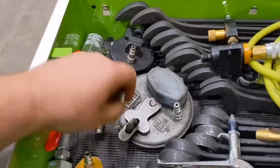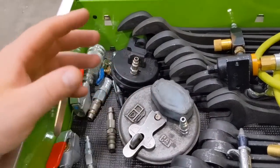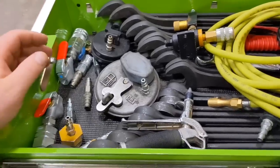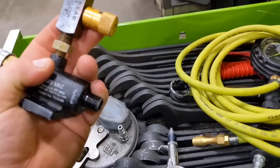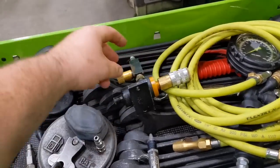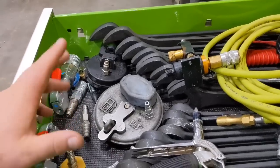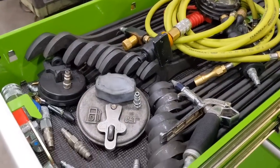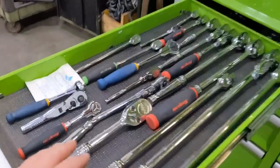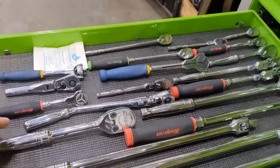I have different variations of things I can use to pull vacuum — even breathers. You just have to really watch how hard you're sucking on different tanks, because if they're plastic you can run the risk of cracking them, so you have to babysit it and get it to the right tempo. Here's one of my favorite drawers — obviously ratchets.